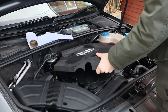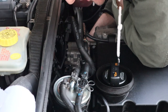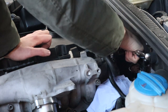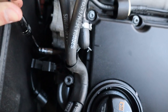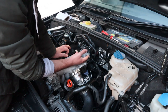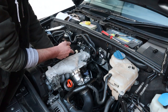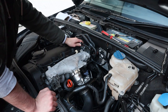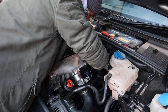To locate the tandem pump, first take the engine cover off. See where the front of the intake manifold is and it should be just to the right of that. There's a bolt right at the bottom which looks quite difficult to get off because there's a coolant pipe right in the way. To get to the third and final bolt, I had to loosen the coolant flange from behind the engine to actually get in with a bolt to loosen it, because otherwise you just can't get to it. As I was undoing the bolt, one of the coolant flange bolts fell down into the engine bay and I've been searching for half an hour and I can't find it. It's three o'clock, I've got probably 45 minutes of daylight left - this isn't going to be done.